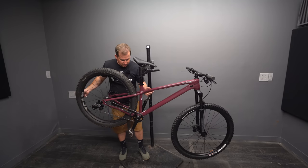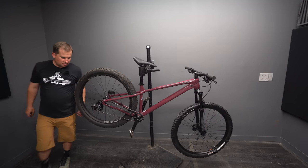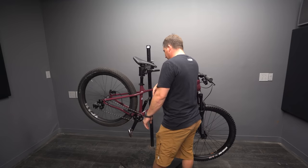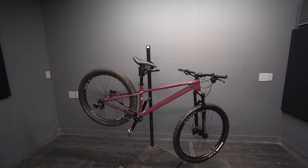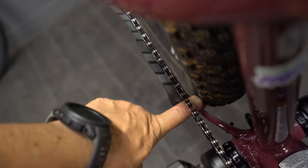Wow, that's really surprising how much room we've got on a 3.0. I'd run it. I wouldn't run it in the UK. No, maybe I would. It's a hardtail after all. Dang, check this out. It fits 29 by 3.0 on a 45i rim.